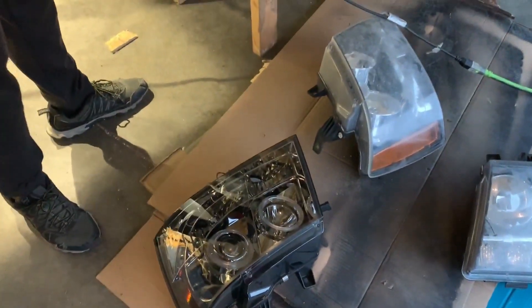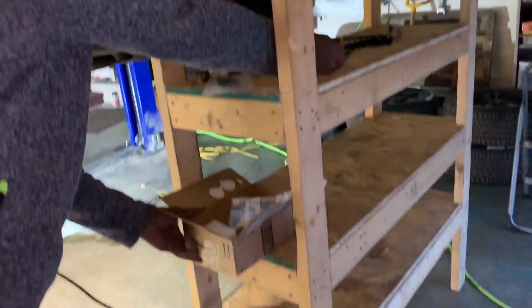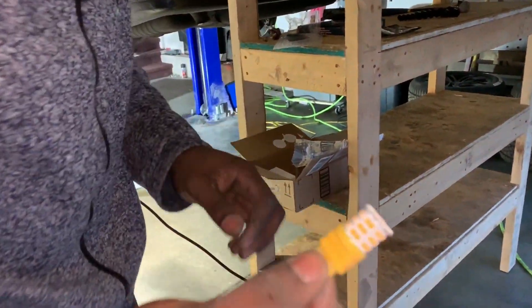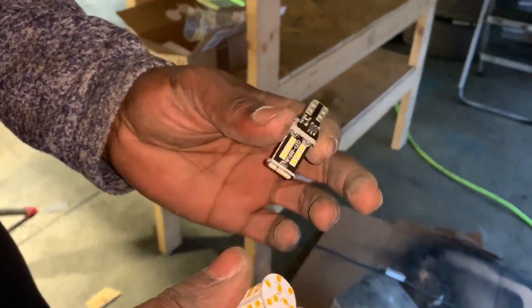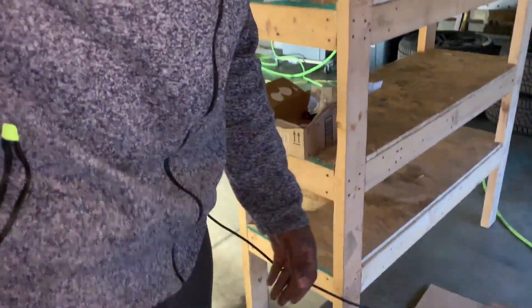We're replacing with this. I'm replacing the DRL — or I guess that's the running light — and the signal. I went ahead and got all these from eBay, real cheap from China, but these are the expensive ones from China, which are still 10 times cheaper than ones in the US. These are the error-free 194 or 921, but this one is too long, so I'll have to get a different one later. For now I'll install these and swap for a shorter one afterward.